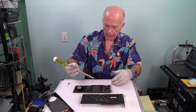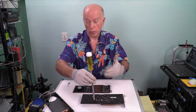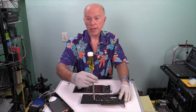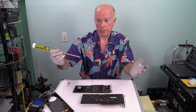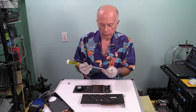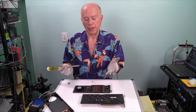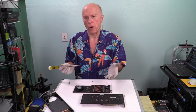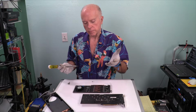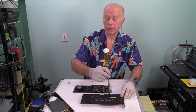We've talked about that. We've done a video on it. And doing the math of what they've provided and what we've seen, those have PLX chips, which is probably a Broadcom chip, as we've talked about. Now the reason I mention that: if you want to put 8 M.2 NVMe drives on a card, you're better off with 4 drives per card because of the switching of the upstream and the downstream ports. In other words, no PLX chip, so that all that's handled by motherboard bifurcation.